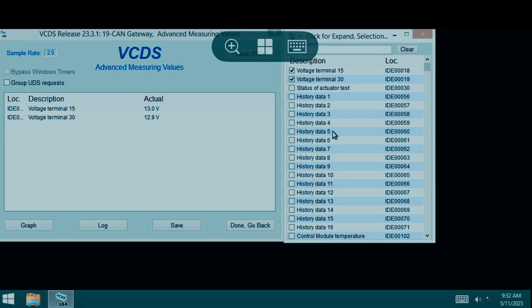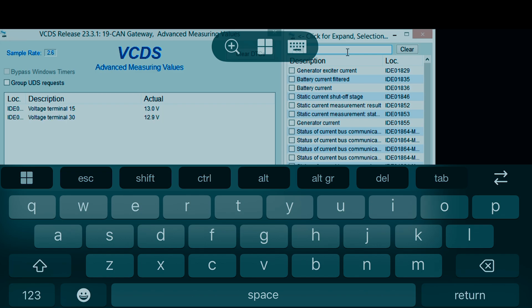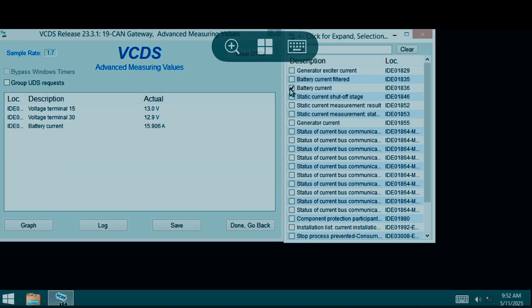We also search for Battery Current. This battery current value is the actual current going in or out of the battery. Here we can see we have positive almost 15 amps going into the battery. Currently the vehicle is with ignition on, so we have around 25 amps consumption from the vehicle, plus 15 amps going into the battery — a total of almost 40 amps currently consumed by the vehicle. If the battery is discharged, the current going into the battery will be even higher, but now the battery is charged and we see around 10 to 15 amps standby current going into the battery.